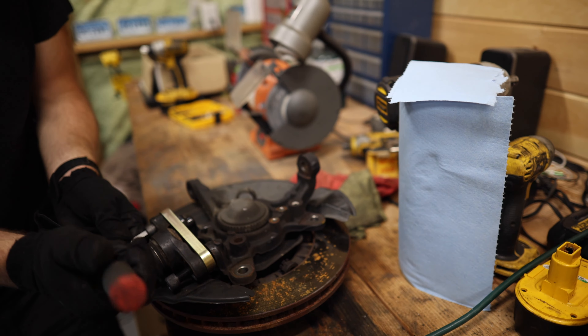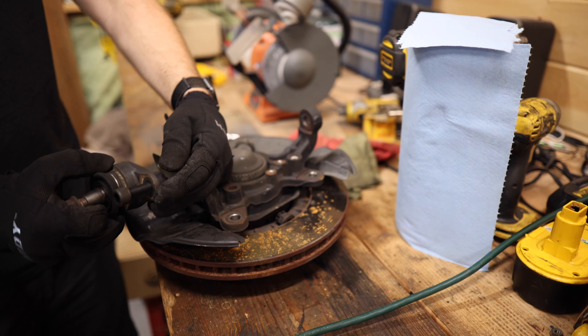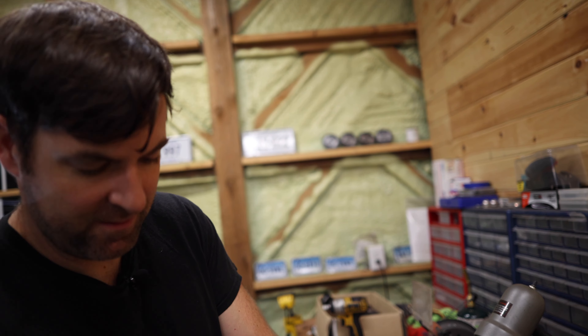This is clever — a clever way to correct this. And it adds one pound of weight per corner. But we're taking off a lot of weight in other areas — we're still about 20 pounds of weight savings for this whole project. I think it's worth it to add the weight just for the negative camber. I'm probably going to run front camber around three degrees. I think it was at 2.6, 2.7 before — that was no camber kit with lowered. So you get a little bit of camber gain lowered. I think we're going to push this out to around three.